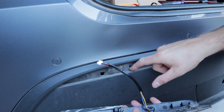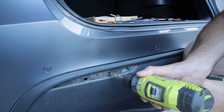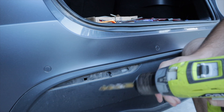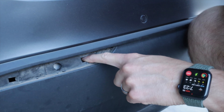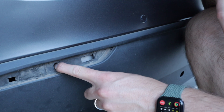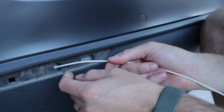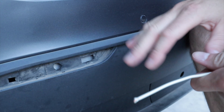I'm going to widen that out and I suggest you do that as well. It doesn't matter what drill bit you use, just make the hole bigger. The main reason I want this hole bigger is there's an aluminum brace right behind it — that's the crash bar, and it's really high up in the Model Y. In the Model 3, I think you'll have a little bit more room back there. We're going to end up taking this wire fish and feeding it right along there, and there's not that much room, so I think this is critical for the Model Y.